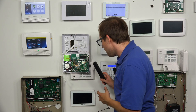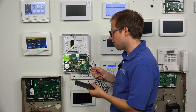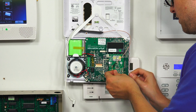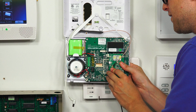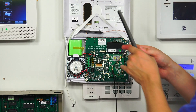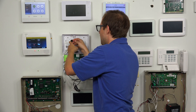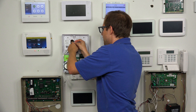We're going to take this one and plug it into the main port, and we're going to be sending it through the back, moving it far away from the system — ideally mounted high up as described earlier. You can see we don't have an adapter here. We just take it and plug it right in, and you get a nice click once it's pressed in. We would mount it high up, but for our purposes we're just going to get it up and out of the way. You want to have the div antenna and the main antenna in separate locations — they should not be in the same spot.